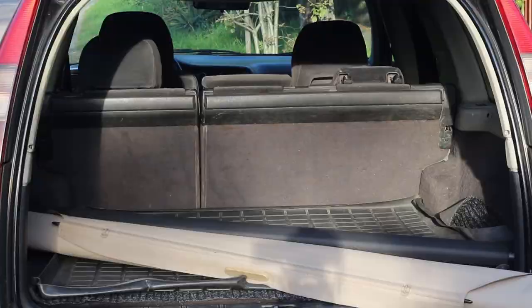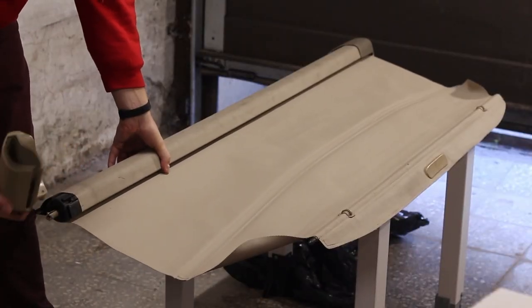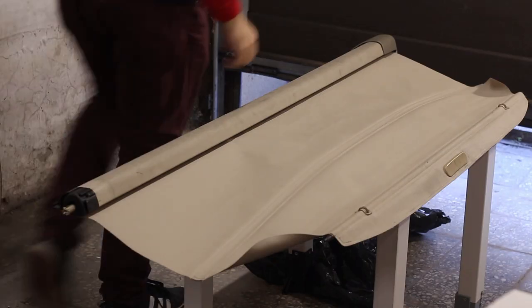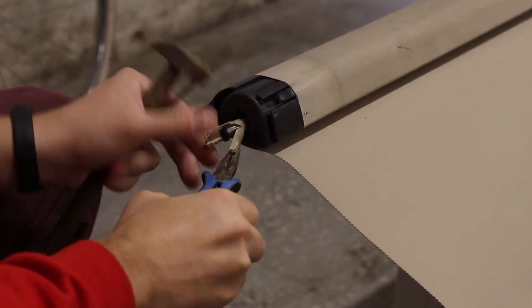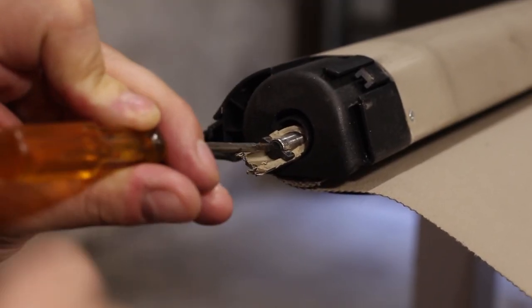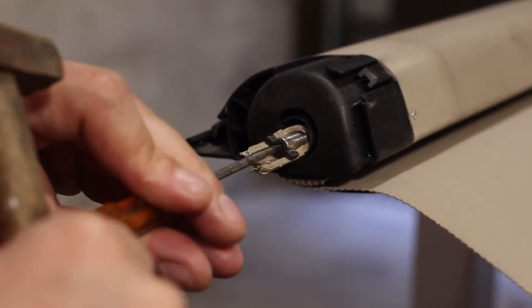Now start to take it apart. Take off the end caps — they are probably broken because originally they are responsible for keeping the spring tensioned. You can see the damage here. If it's not totally broken, just one side, you have to break it now. It's just a matter of time before it breaks. Start to remove what's left of the original spring tensioner. Break off the parts you can so you can reach the little black plastic rivet in the middle. Now you have to hit the center of it — it is the center part which keeps it in place.